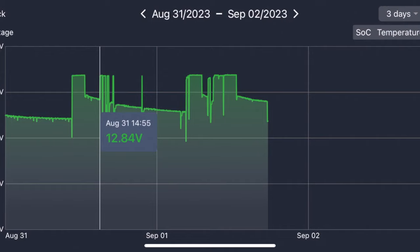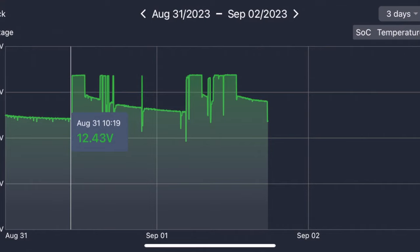If the car doesn't top up the battery, it'll keep going down until it goes flat — and that has sometimes occurred with the Atto and other electric vehicles. When driving, the battery sits at around 13.7V. When you stop the car it goes back below 13V and then drops quite rapidly. This spike where it drops to 12V is the battery under load — like when you crank a petrol car's starter motor. It requires a huge amount of energy, so the voltage drops right down to 12V. For a healthy battery I wouldn't expect it to drop that far — it's a bit concerning.